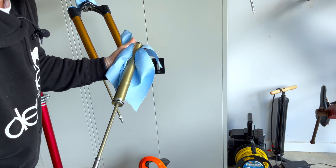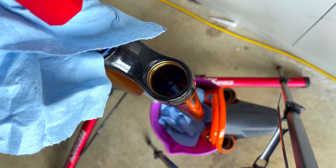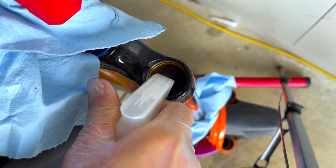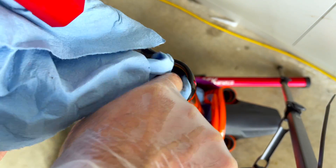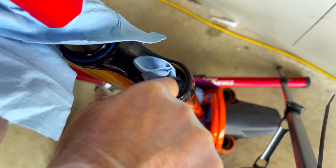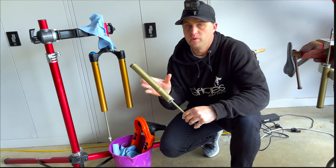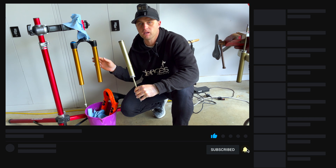This is a 180mm one, so I'm going to rebuild this one and put another one in. Now we've got to clean out where the air spring rods in the bottom. Get your isopropyl alcohol and give it a good squirt in there with your shop towel. Poke it in with a poking rod to clean it out. With the air spring removed, give it a really good clean with isopropyl alcohol.